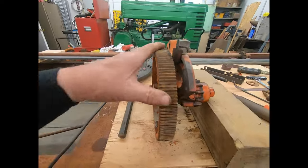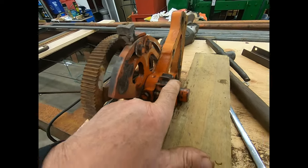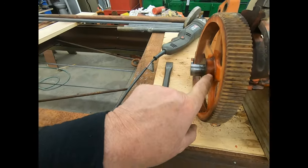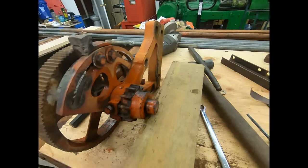Anyway, time to get out the torches. I've been trying to get this apart - I can't get this set screw out. This one here I got out, but I can't start this one, so I'm gonna put a little heat to it and see where it goes.